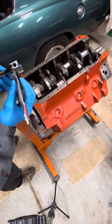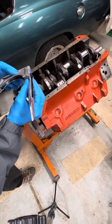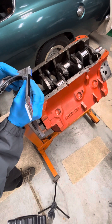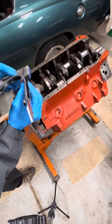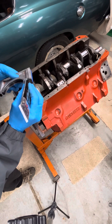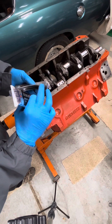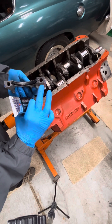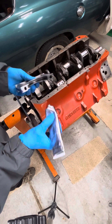What we want to do here is get a little bit of this RTV on this sealing surface. I've cleaned all these, so I'm just going to get it on here — not too crazy. You don't want it to get all smooshed out into the crankshaft itself, but you want to make sure this is going to be enough to get against the block and create a good seal. That's looking pretty good.